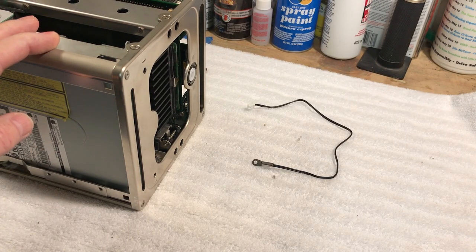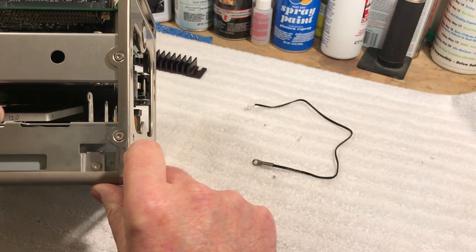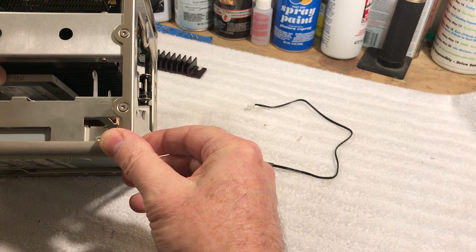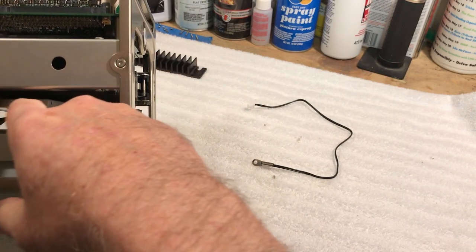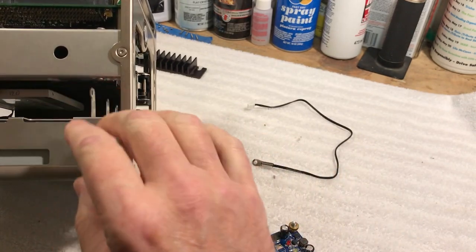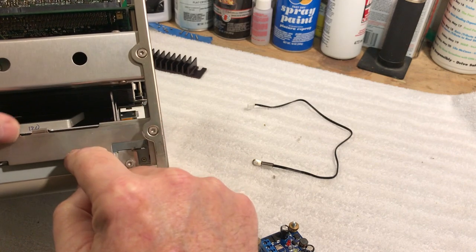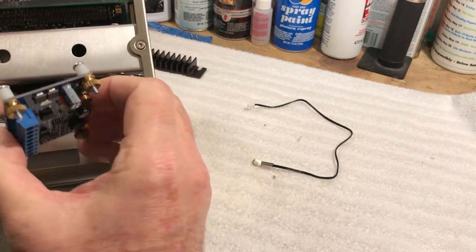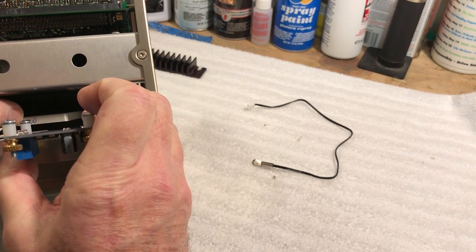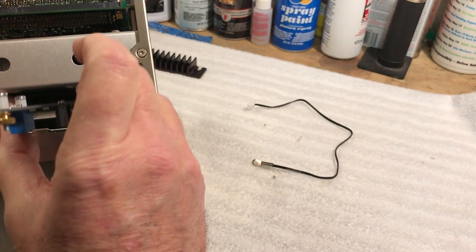We're going to be putting this in the Cube, and I've been thinking about where to put it - there's actually plenty of room in here to mount it. I've got the heat sink off. This is where the normal hard drive would go but we've been running with a three-partition crucial SSD. We're going to mount this in the optical drive space, and I really want to try to do this without drilling any holes. It already comes with standoffs, and if I use some washers I could actually put this in and tighten it down without making any holes.